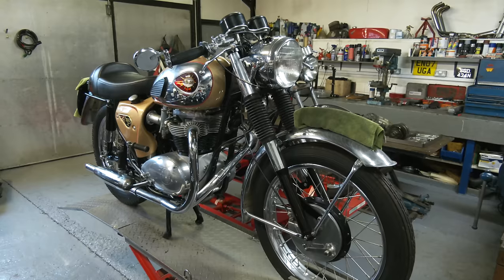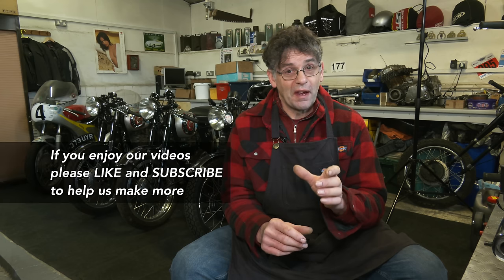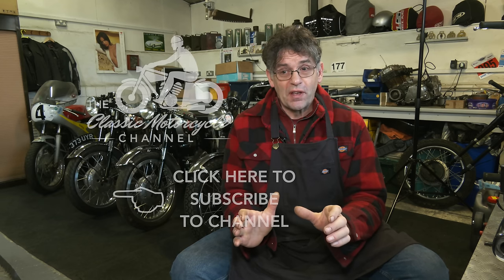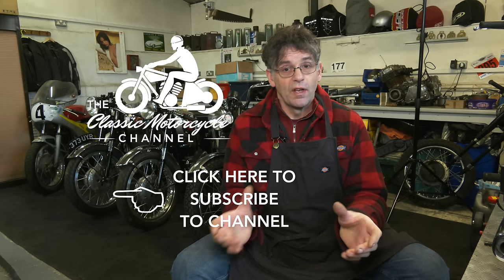When looking at these old bikes, don't be too taken in by anything that's been highly polished and recently repainted. Although it might look attractive from the outside, we don't know what's going on inside. I'd be more inclined to buy a bike that's been in regular use and hasn't been freshly commissioned. If it has, you want some sort of guarantee or comeback if it's from a dealer. I come across this all the time — something looks nice and shiny, and when I start taking things apart I find issues that can be quite serious.